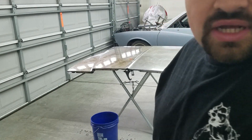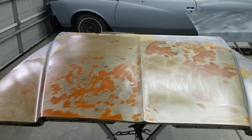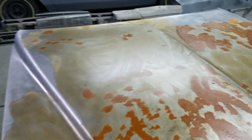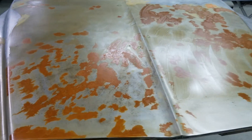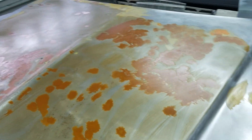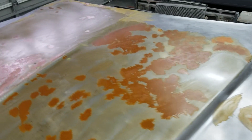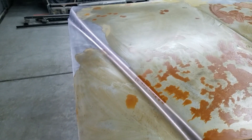Now it's just waiting, letting it sit for about 10 to 15 minutes, then come back and clean it up with clean water and a scotch bright. I only hit the areas that had the surface rust — I didn't need to hit the whole hood. That was pretty easy. It's been about 20 to 30 minutes now, so I'm gonna start hitting it with clean water and a red scotch bright. That's pretty much what it looks like after the four parts water, one part white distilled vinegar treatment. I only hit the areas that had surface rust — this area didn't have any, pretty clean metal.